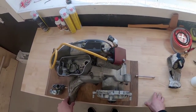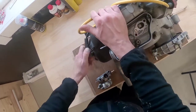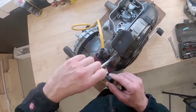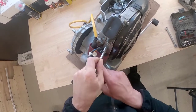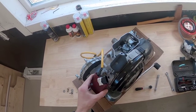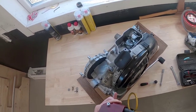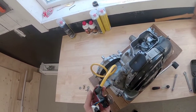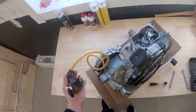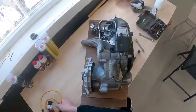So I'm going to start with this CDI box. I have to remove the cap. When we installed the DR-177 kit on this motor, we also installed this CDI box. It's a tuning box — it takes out the rev limiter so you can rev more. But I have bought a Polini ignition system so I will not have any use for this anymore, so I will remove that.